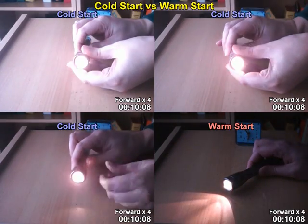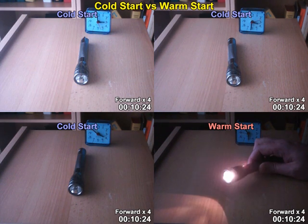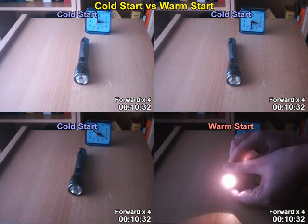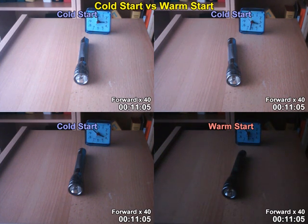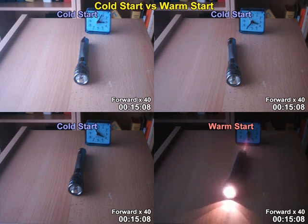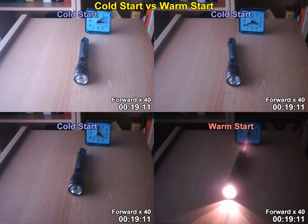We can also explain now why the flashlight trick doesn't work when it's started without a certain heat-up time. In order to break the insulating layer, the contacts need to be pressed against one another, which can only be achieved by contraction of the reflector. But if the reflector was only heated up a little, then it has also expanded just a little, and then it doesn't contract enough to break the insulating layer.